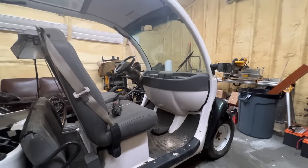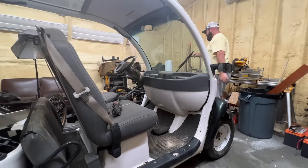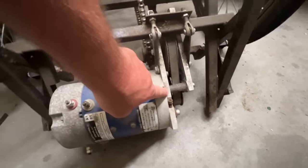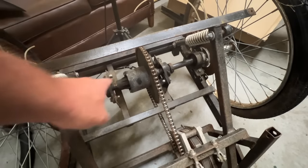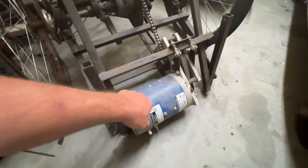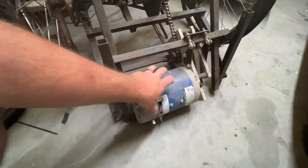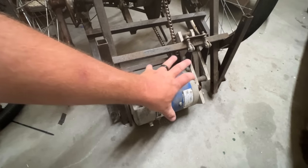The shop is a mess — I have stuff everywhere, review videos I still need to do. I still got parts of the SunEV truck here. This motor from the SunEV isn't your typical golf cart motor — it has a keyed shaft going to a belt drive acting as a jackshaft, then going as a chain. It has a Peerless differential axle, so you get differential action in turns. That's one of the main reasons I scrapped the SunEV — I just wanted this motor, that rear axle, and the chain to make go-karts or other things.